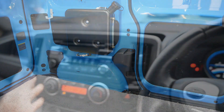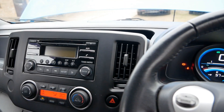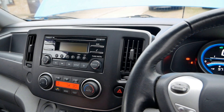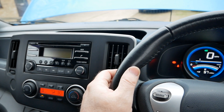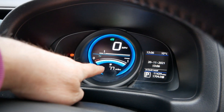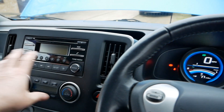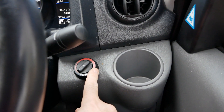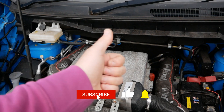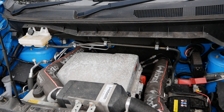The diesel heater is a lot more efficient and produces a lot more heat, but of course you're producing emissions which ideally you don't want to do. But if you've got a small-battery EV it's a great way of making that vehicle a lot more useful in the winter without seeing that range loss. Turning the factory heater off — it's an estimate of course, but we're losing about 20 miles of range by running the factory heater, whereas we'll be using zero range running the auxiliary heater. I hope you found that useful; please do click the thumbs up button on YouTube, comment and subscribe, as new EV videos are on the channel every week.